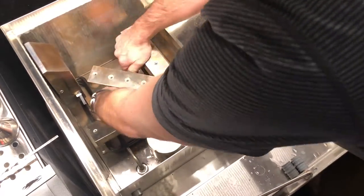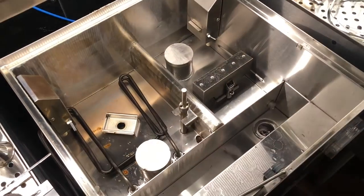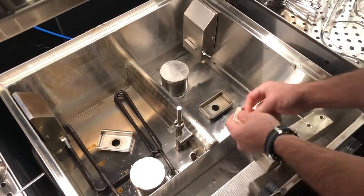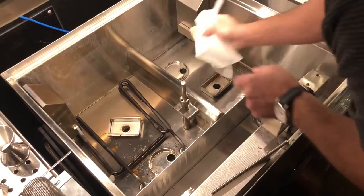The water on the wash side will be hot. Unlatch and remove the spray boxes. Remove the rinse tank guide and drain screens. Check spray boxes for seeds or debris, and wipe out the components and the walls inside. Let them air dry or wipe with towels, then replace all the parts.